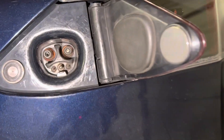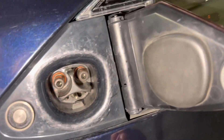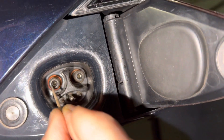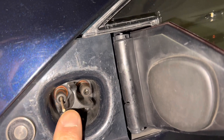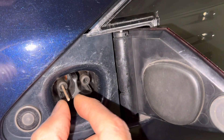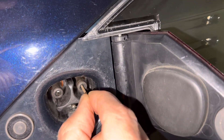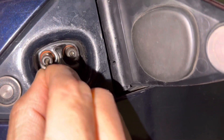I can't charge because if you look carefully the left side pin has been blocked — there's a little piece of something in here. It's like the tip from one of those supercharger handles. And if you look carefully, this toothpick only goes in that far on this side, but on the other side it goes in further. So there's definitely something obstructing in here.